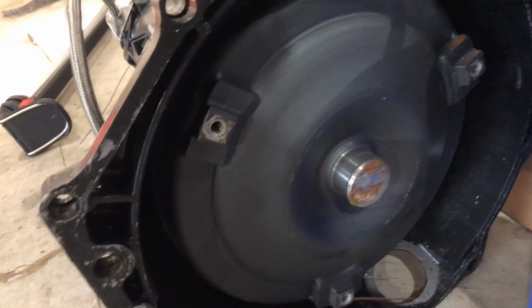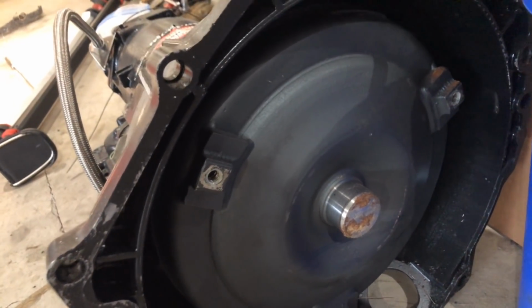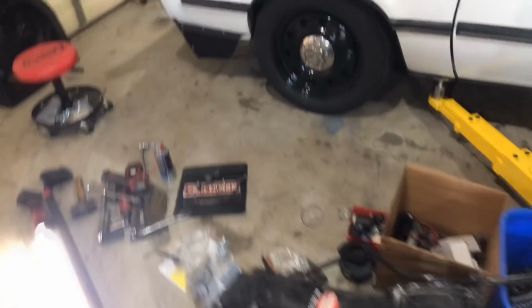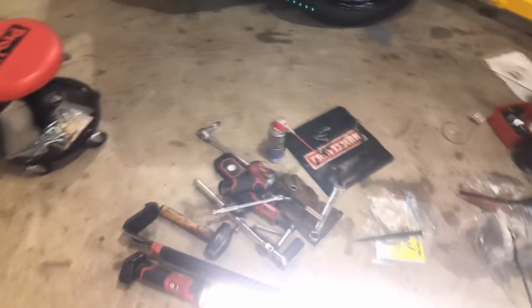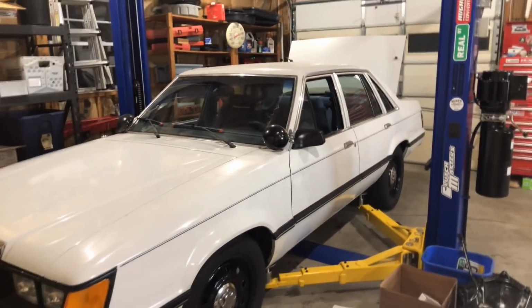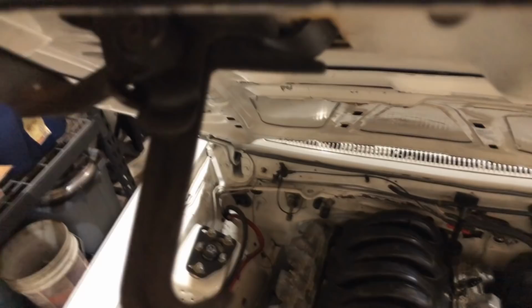There were no torque converter bolts directly with the 6-speed, so I took the 4L60 ones. They're the same, and I threaded it right in, and started to button up some stuff and checked my power wires for the starter. Bolted a starter in. The other neat thing, let's pop this guy loose. Show you guys what I was up to. I was just checking out the belt routing.